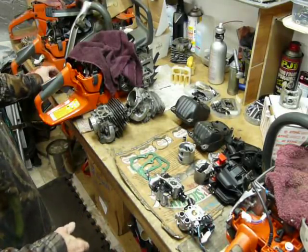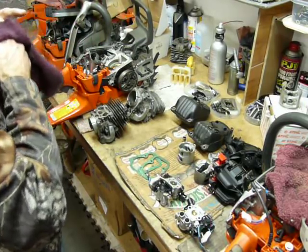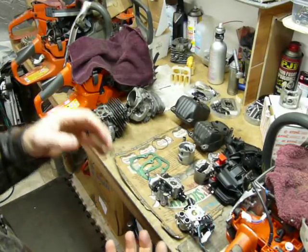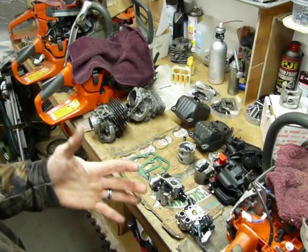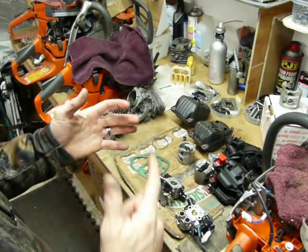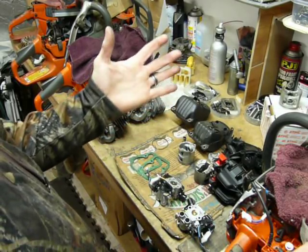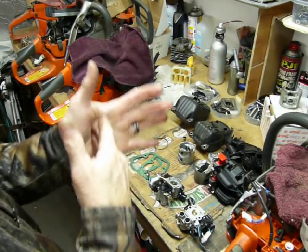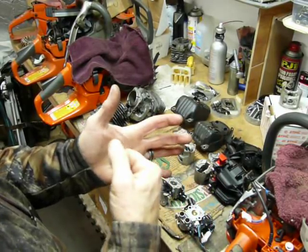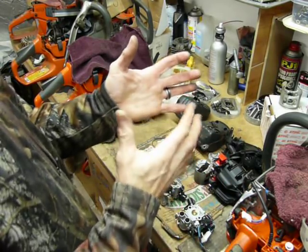That's why I'm always harping on mix oil with these new saws that have sloppy tolerances. You want a mix oil that has a good density to resist being crushed. Let's talk about rotation. The engine rotates, obviously the piston's going up and down, but there's centripetal force. It's trying to stuff that piston up against the front of the cylinder wall. You want a good density oil to help prevent it from being crushed. That'll help the piston slap, if you will.